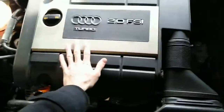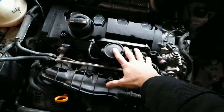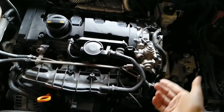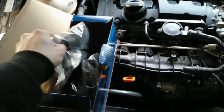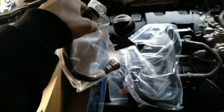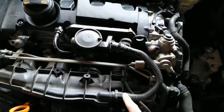To replace this part you need to remove the engine cover. Locate the PCV valve — it's typically a good idea to take a picture of it so that you know which hoses go where and how they're guided. This set includes a new PCV valve, a new set of hoses, and new screws and a new gasket. Remove all the hoses.